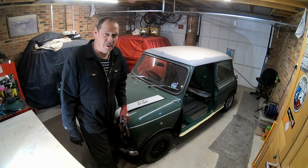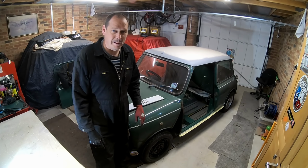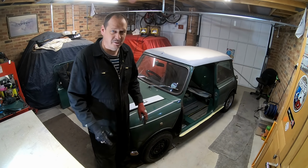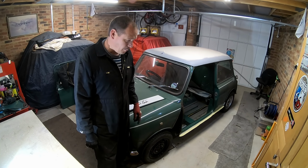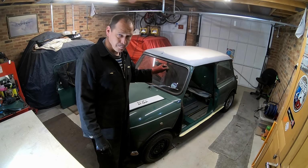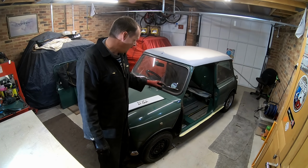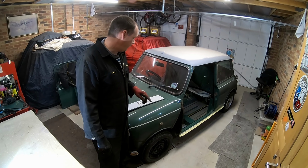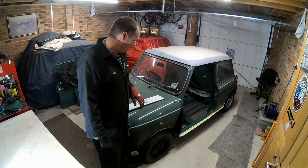Right, well that's it for the moment. It's getting late now, I've been on the car all day. I've got the other side done, sill on, inner sill repaired. I've cut both A panels off as well, and it looks like the side I've just done, I'm going to have to have a full flitch panel on that side.